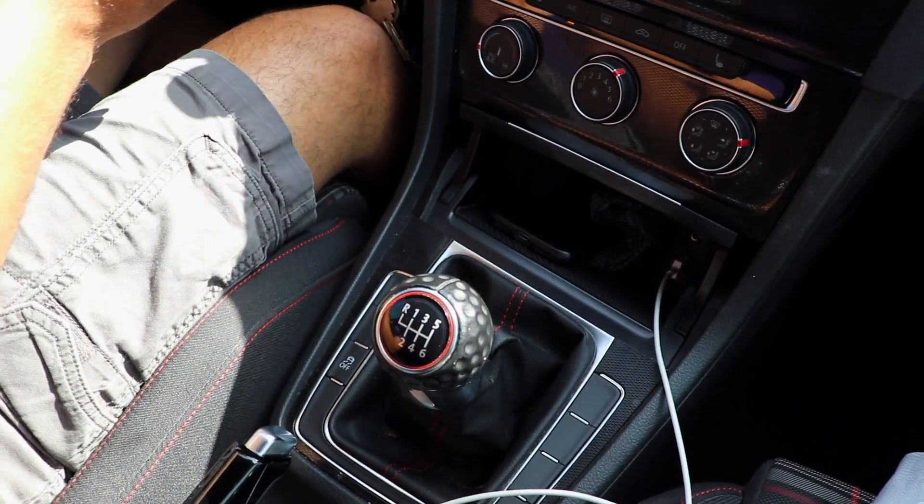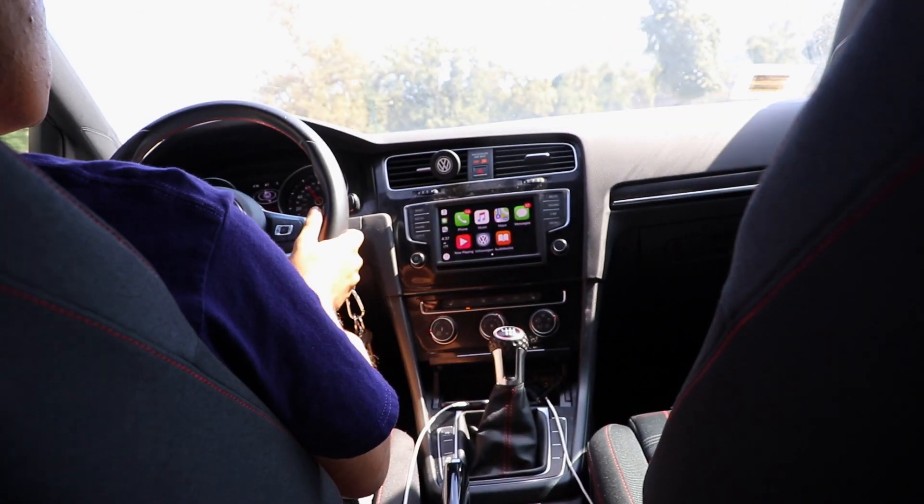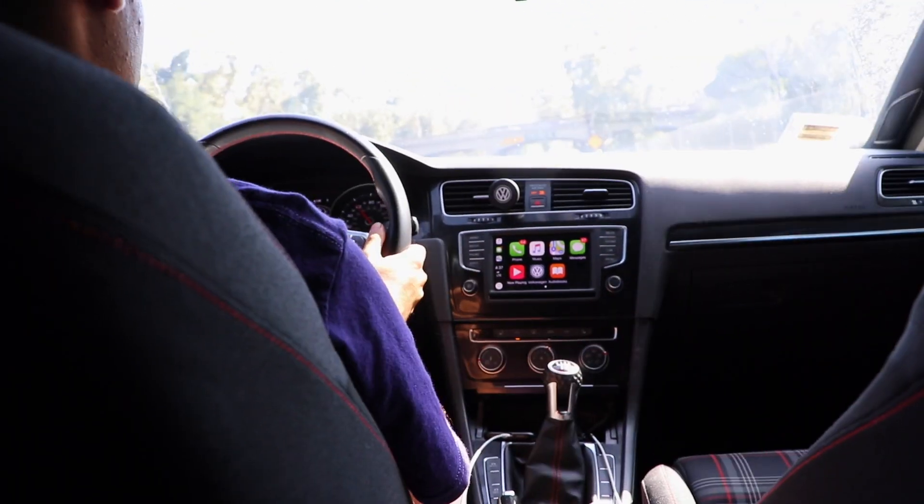You will pick it up instantly. When you're cruising on the freeway, I recommend being in one of the upper three gears — fourth, fifth, or sixth. Unless you're in traffic going 30 to 40 miles an hour, then put it in third. If you're going less than 20 miles an hour, put it in second. You don't want to be in a lower gear when you're cruising at high speeds — it kind of overruns the engine, it wastes gas, the car drones, it's just not great for the car and it costs you more money on gas. The engine's rotating quicker because the lower gears are lighter.